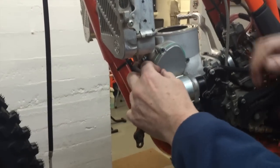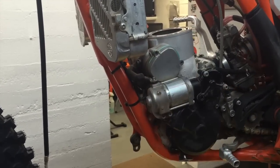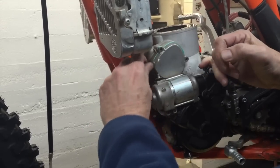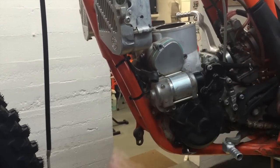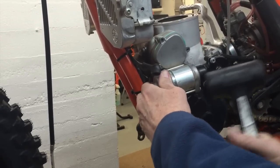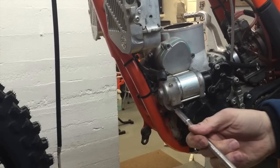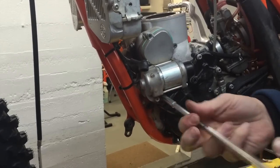And back down here, loosen this nut, this main cable going to the electric starter motor. That requires a 10mm wrench. Pull the cable up. So now the cable's not hot, so you don't have to worry about it. Now this motor, sometimes they'll push right out, but that's what I have the dead blow hammer here for. It's just a tap on it. But it would help first if I took the bolts out. Got a little ahead of myself there for the video.